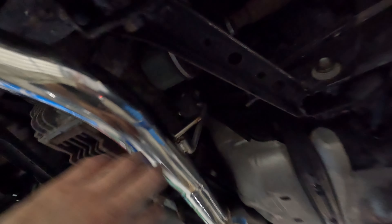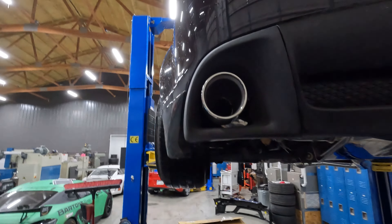All right guys, as you can see, that went in there really well — fitment is spot on. It uses all the factory hangers, and luckily all the factory hangers were still there even without the muffler; the little rubber mounts were still up there. Got one, two, three, four, and then this front section has a mount there that bolts up. It still has the factory studs, so I'm going to create some little spacers out of some pipe I have. The tips fit really well, no real adjustments at all — this fits really well, you get what you pay for kind of deal. Let me get this all tightened up, car lowered down, and let's see what she sounds like.